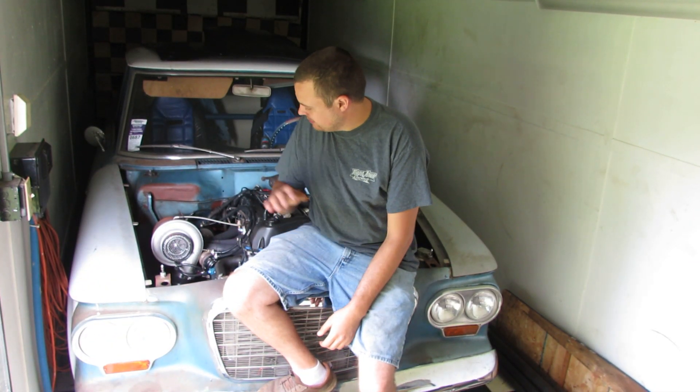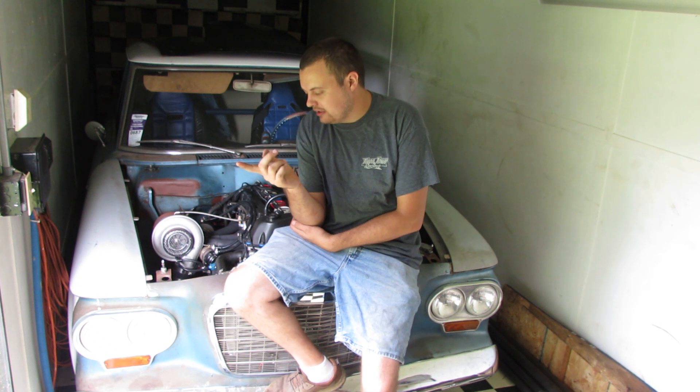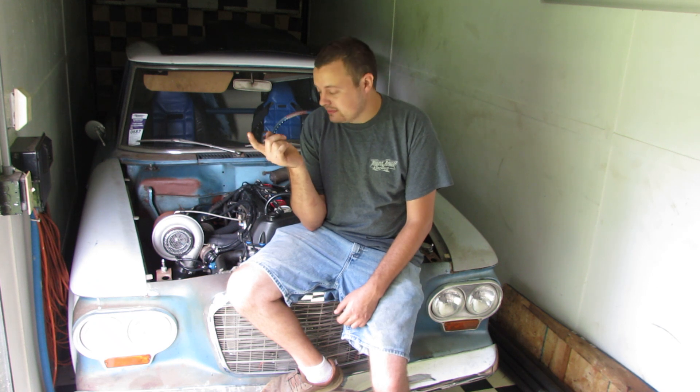I am pretty happy with the new turbo. As you saw, we took it for a little street drive and overall it's performing very well. Earlier we talked about two points of comparison — first was how much boost does it make on the two-step. As you saw on the clip, it made about eight and a half pounds of boost, and the old turbo also made about eight and a half pounds of boost. So we've lost almost nothing there, which is really encouraging because this turbo should be capable of 200 to 300 more horsepower than the old turbo. It takes a little bit longer on the two-step to get to eight and a half pounds, but it still gets there.